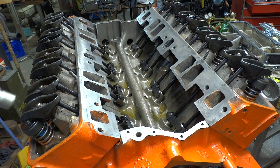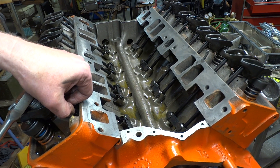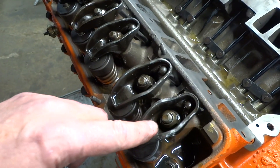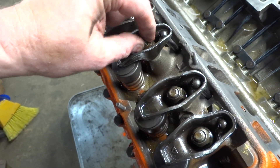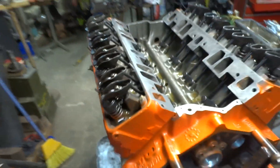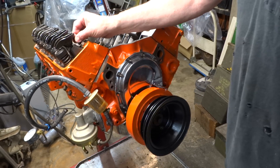All right, I just did all these — now do these, and these. One more little note: you see these nuts? They're rounded towards the top. The rounded part always goes to the top — the flat side goes down. If you put them in backward, take them out. Okay, we've adjusted all these to zero lash, which means they won't turn at all.